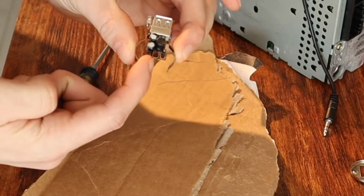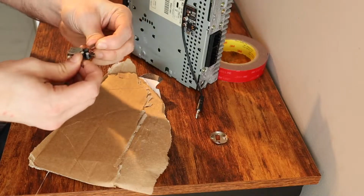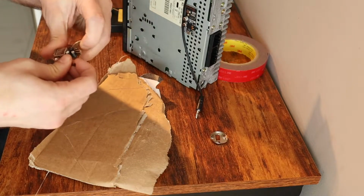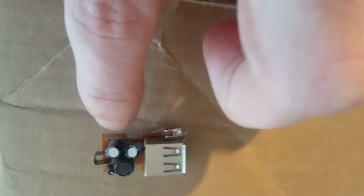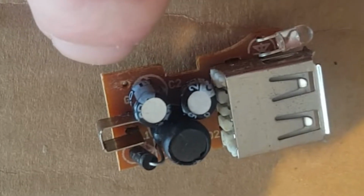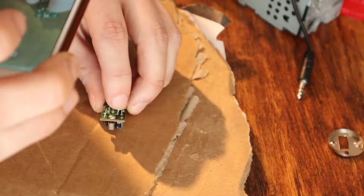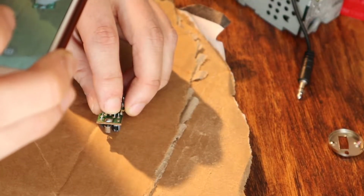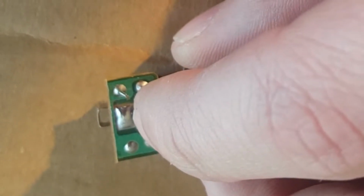So right there, that's power into the board. And then these exterior tabs, these were for the ground. We are actually gonna just break these off because you're not gonna use these. Oh, well, that was easy. Right there was power in. See that little hole there? There's actually a little G next to it, so that's ground. This big set point here, that's power in. So we're gonna solder a wire into there for power, and then solder a wire into that little point for ground.